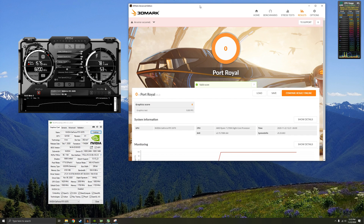As you can see, we crashed. When you crash in a benchmark, it means one of two things: your core clock MHz is overclocked too high, or your memory clock MHz is too high. We were able to run a successful benchmark the first time with +100 MHz core and +1200 MHz memory, so I believe the core clock is just a little too high. You want to run this a couple times once you narrow down a stable overclock, so you don't crash in games like Call of Duty. An unstable GPU clock is just not fun.